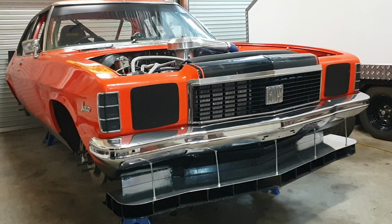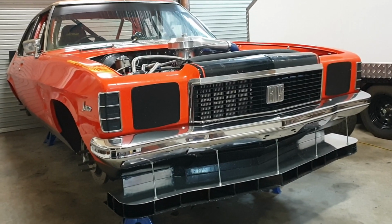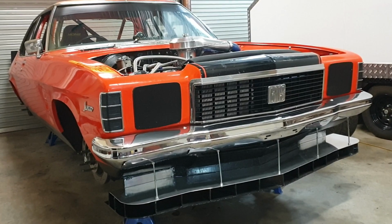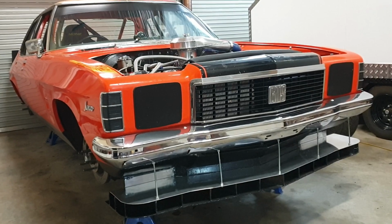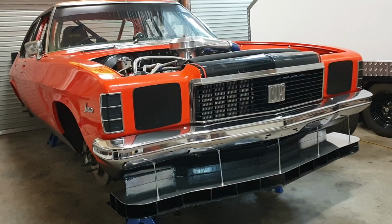But anyway, I went out and did sort of like 10 laps, and I thought, I'll give it a run on a race and just see how it went. Anyway, it was too fuely, and I thought if I can get some heat into it, maybe it might improve, but it didn't really help. Anyway, I came back and I thought, bugger it, I'll pull some jetting out of it.